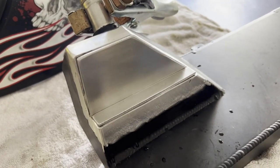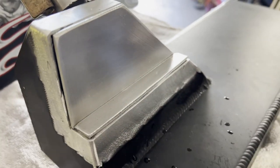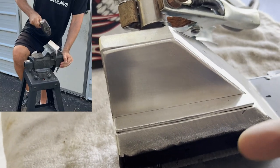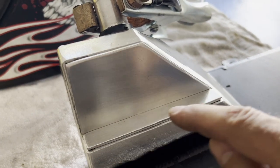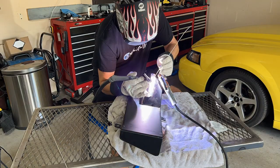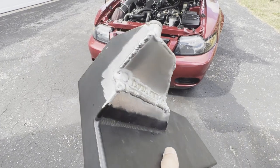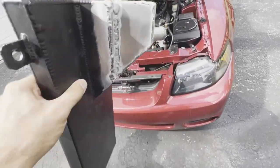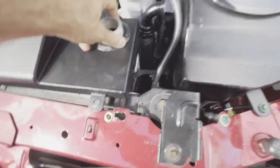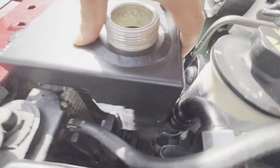Here's the panels ready to go in — looks pretty good. It's a little intimidating to weld aluminum this big with just a hobbyist welder, and that 90-degree crevice in the center is a tough one. I tried bending this as one piece multiple times but the aluminum is pretty thick — point one two five — and it kept cracking down the center, so I had to make it two pieces to weld together. I'll weld it up — not the cleanest welds by any means, I really do need to work on my aluminum welding, and some of the prep work caused impurity issues — but it's sealed and we now have clearance. The mounting tab holes line up so it's going to do the job.